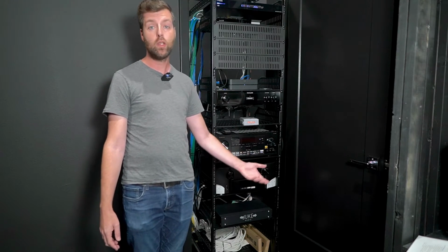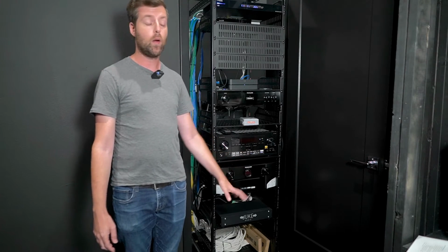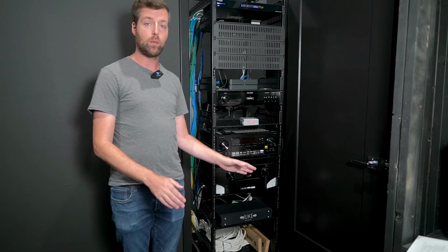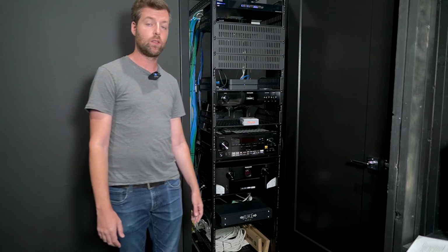And as I said, you could always use this device as is, but in those particular zones where you do need more amplification, simply use a line level converter. It'd be great if it had RCA outputs, but the whole purpose of this product was to be as simple as possible. And so it doesn't have that. It only has speaker outputs. It's a limitation, but it's one that, as I said, a line level converter can fix.